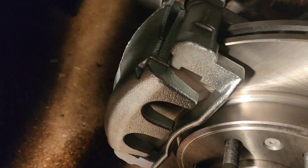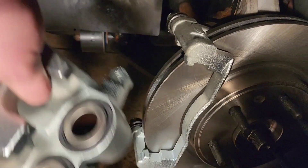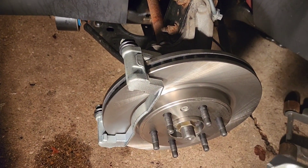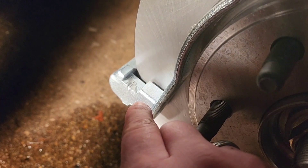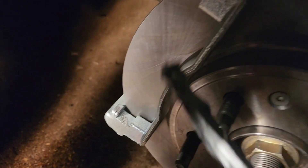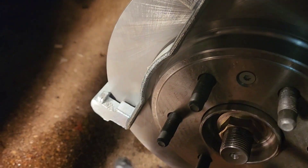Caliper pin bolts are out. I have it sitting here right now because the brake hose is yet to be connected. It's going to be much easier for me to take the whole caliper off, start putting on the pads, then when I put everything back together again, connect the brake hose and get ready to bleed. One little trick before you install the hardware — just put a little bit of anti-seize, maybe about that much, on the bump here. Careful not to hit the rotor with it, but just on the mounting points where the hardware is going to be. Just a little brush on each area — that'll do you good in the future.